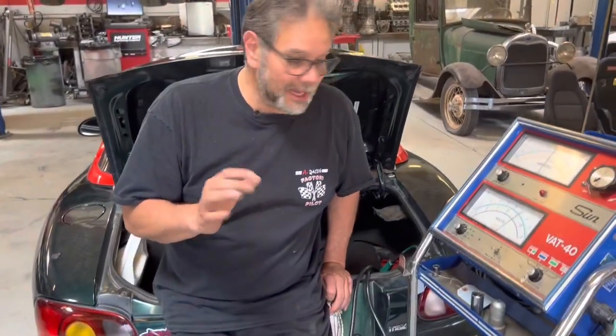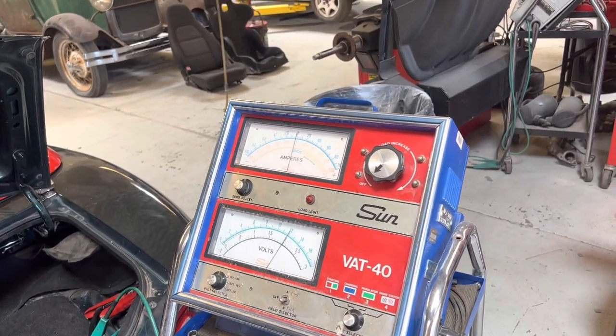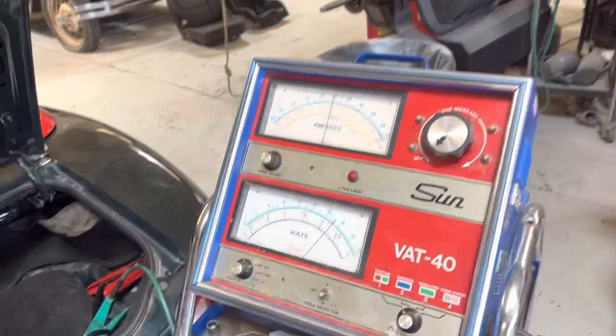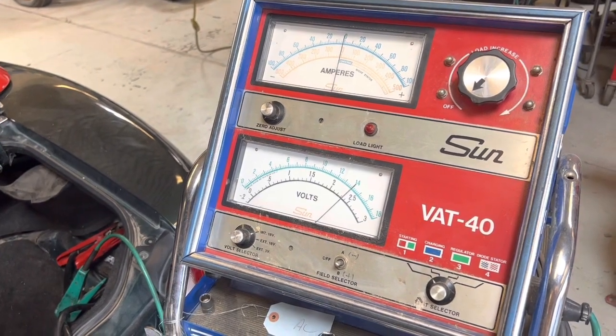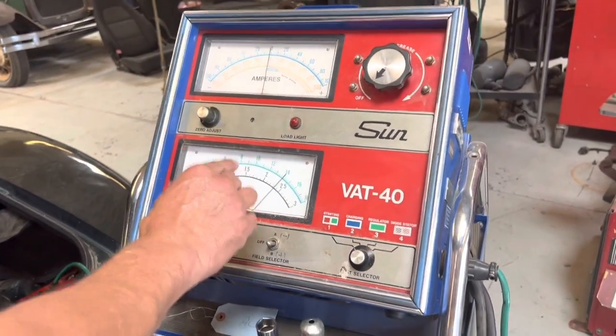We're going to fire this up and check the voltage it puts out. Then I'm going to load the system up — when I say load I mean turning on the lights or cranking — and simulate that with this load knob like I did for the amperage. I've got my partner in the car, Mike filming, and I'm going to do this. We see 12 volts. Go ahead and start the car and hold it steady around 2,500 RPM. You can see we're at 14 volts and that's where we should be — that's pretty good voltage. The voltage regulator is working since the vehicle went from 12 volts to 14 volts.